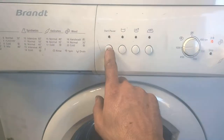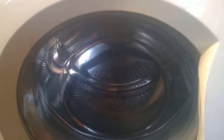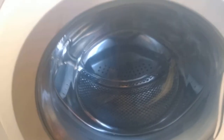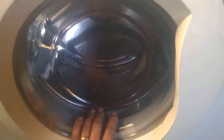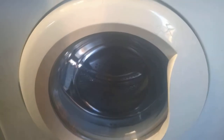What we want to do is hit the start button. We want to hear the lock closing, then the relay will click and the motor will start — after the drain pump, of course. Door is now locked. Drain pump has started. I heard the relay clicking but the motor is not running — so this does not spin. Usually what this is, is either worn-out carbon brushes on the motor or a bad drive belt. Since I cannot hear the motor rotating, it's probably the carbon brushes. So we need to flip the machine on its side and check the brush condition.